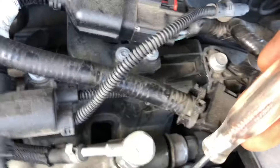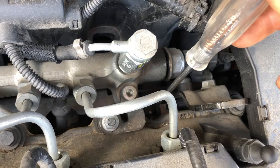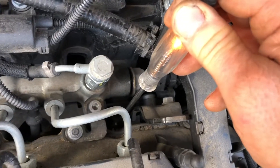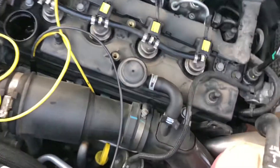I'm going to go over to number four. I was questioning whether cylinder one was the timing belt side or gearbox side. When I touch off the glow plug here on cylinder number four, you can see that my bulb lights again. So cylinder number one is testing good with a test light.